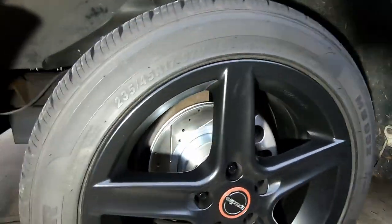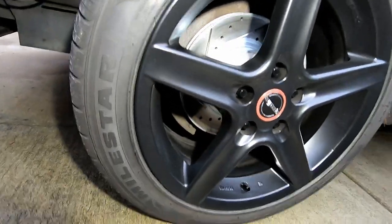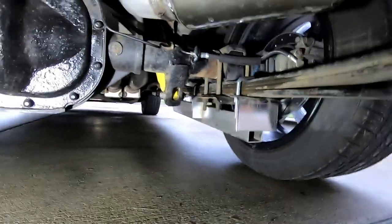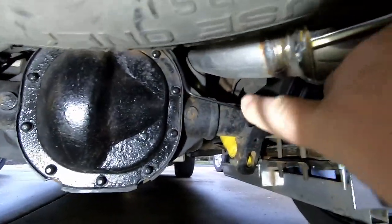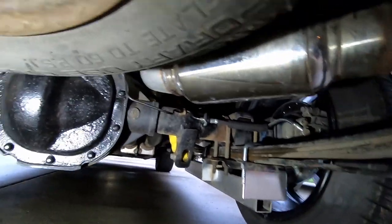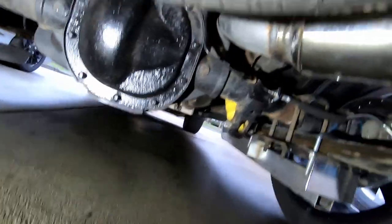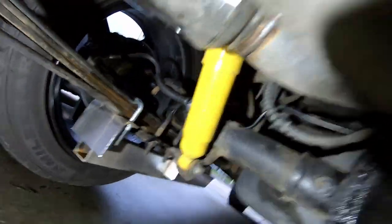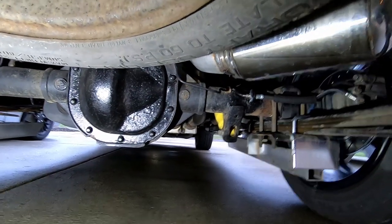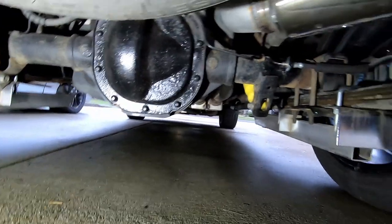I did end up doing new fronts as well — same Detroit Axle rotors off eBay. I also took a spare set of factory brake hard lines off my old 7.5-inch rear axle. I needed to do some double flaring anyway for another project on the truck, so I cut the 7.5-inch axle brake lines down and re-flared them to mate up with the Curry hoses. That eliminated all the having-to-bend-a-loop-in-the-line nonsense — much cleaner install with a more factory appearance.